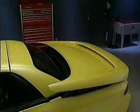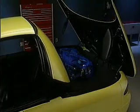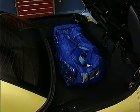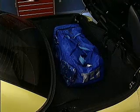Because the hardtop is stored in what would normally be the trunk area, it's important that the area is clear. If an object is detected in the hardtop stowage area by the object-in-trunk sensor, the hardtop will only open halfway. Closing the top on an obstruction could cause anything from minor scratches to serious structural damage. To avoid this problem, the object detection system uses a pressure-sensitive mat bonded to the floor of the trunk to detect objects that might be in the hardtop storage area.